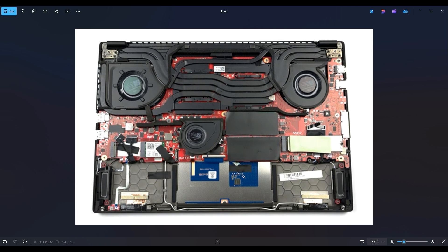To operate this, there's a screw on the right — you undo that screw, take off the plate with its thermal pad on top, and that will release your solid state drive so you can pull it out of the port. Upgrading your solid state drive and your RAM are great ways to improve your computer's speed. If you do install a new drive, you'll most likely need to install an operating system. Below in the description I'll have two tutorial links — one showing how to install Windows 10 and the other showing how to install Windows 11.